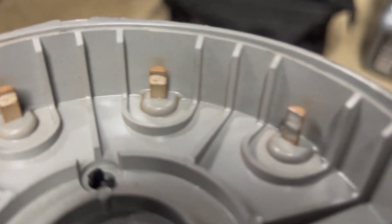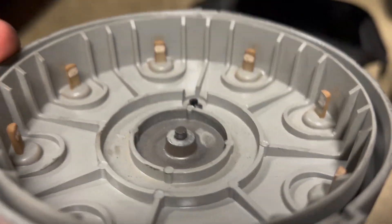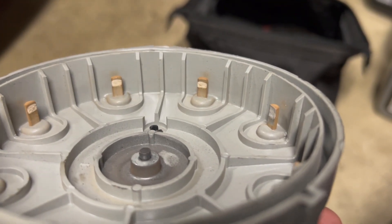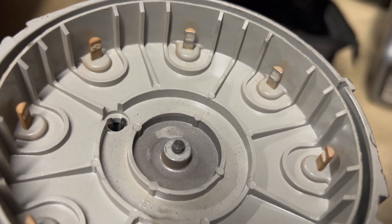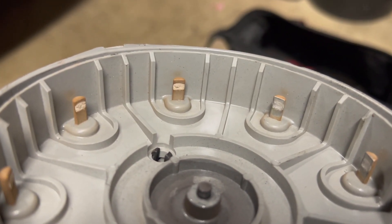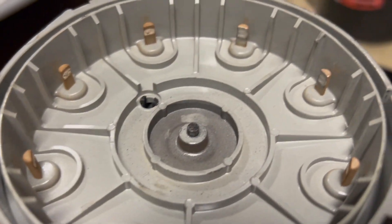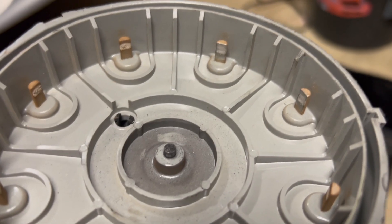It's not bound up, not stuck. There's no moisture in the cap, however there is some buildup on the terminals. I've already cleaned off two, I'm going to clean off the other six, put everything back together, start it up, and see if it runs any better. My working theory is that there's just some buildup on all these terminals causing the misfire - enough buildup to cause the issue but not too much to prevent the car from starting.